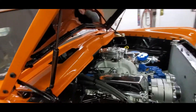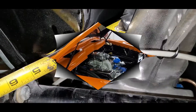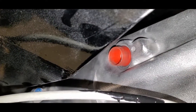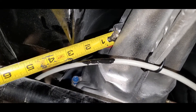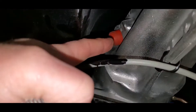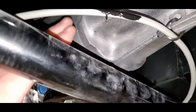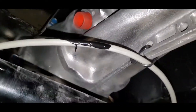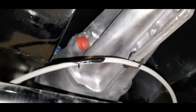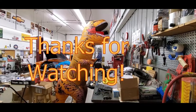Here is the area I'm worried about on this transmission — you can see that's where the speedo interface goes. I get a little less than two inches, and the pulse generators I'm seeing are pretty big, so we need to come out under two inches, kick back, and then screw our pulse generator on there. We're also strongly thinking about making a plate that can bolt on here, plug the hole so it doesn't leak fluid, and buying the GPS adapter for the Dakota. That could be an option. Anyway, that's going to wrap up the Henry J video — this has been another ShopWrex-approved video.